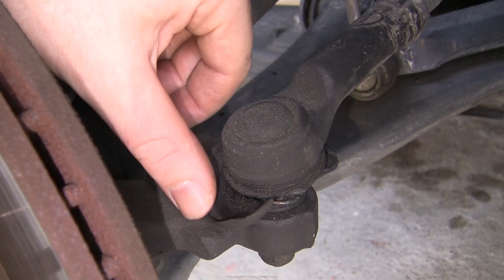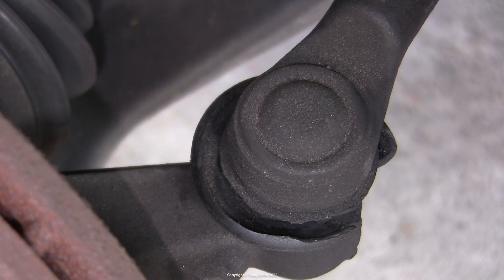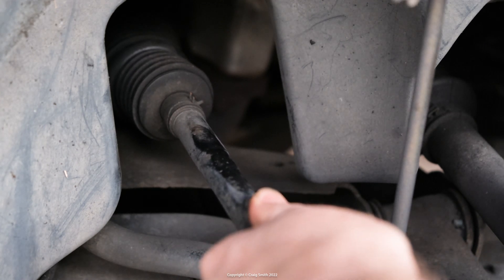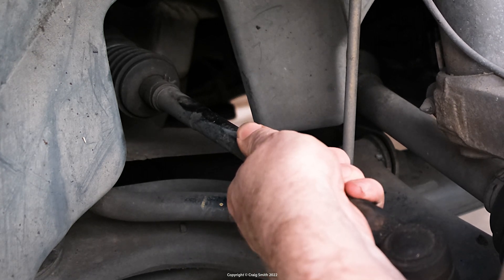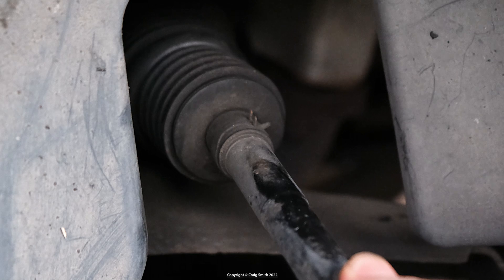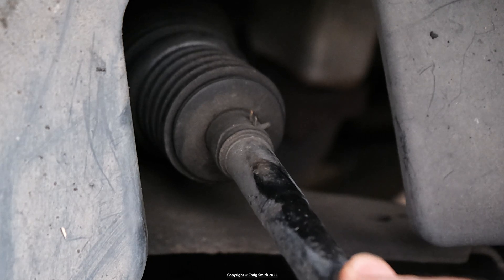I did a video on checking tie rods, so check that out if you need to. If there's nothing obviously wrong with the outer rods, you'll have to focus further in. Here you can see the inner rod is the one moving with the play. On my right-hand drive car, this is the right-hand side with the play, whereas there's none on the left — that's actually a sign it's more likely the rack, not the rods, because it's the steering wheel side that tends to present wear on the gear. If the rods are failing, quite commonly if one has gone the other will too, so you should look at both sides.